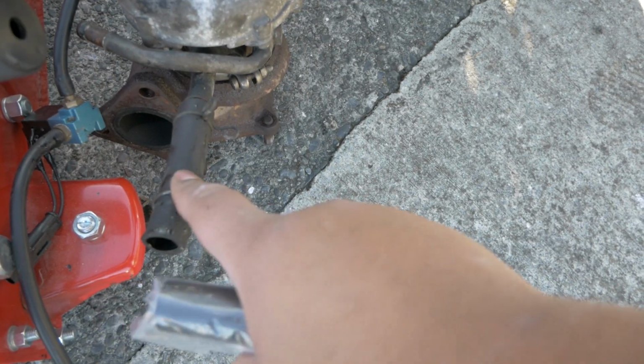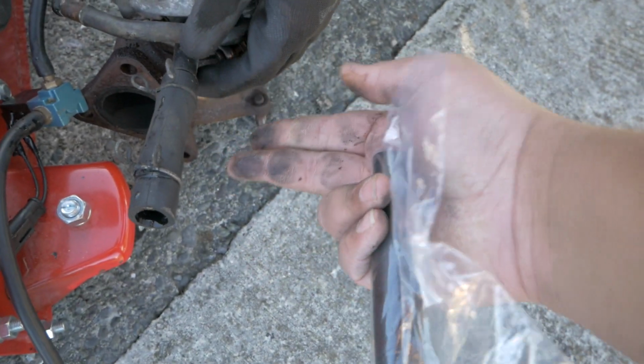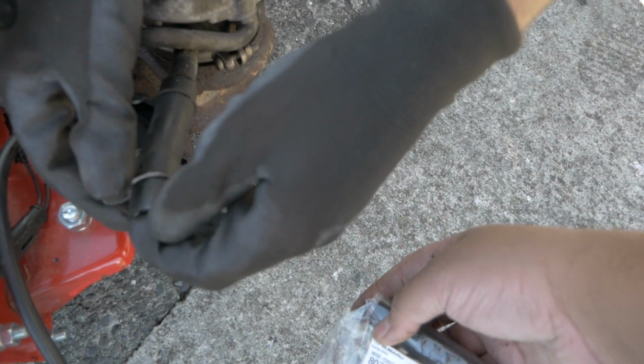So yeah, this thing here is what's causing my turbo to smoke, because it's leaking. It's covered and caked in oil actually. I reckon it's just because it's not compressed on there very well. See, look, it's loose. Like this came off. I don't even need to undo that to take it off.